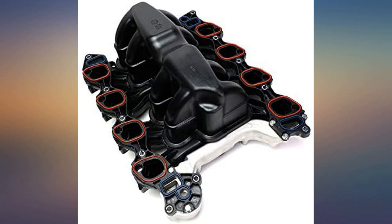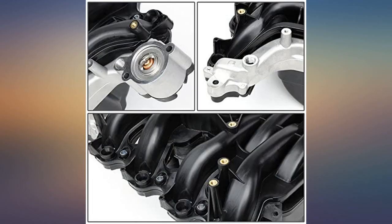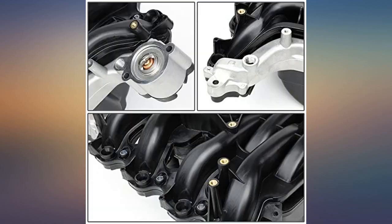Fit my 2003 Town Car with original alternator bracket. Use the coarse thread screws supplied to secure the coils. The intake manifold bolt torque spec is 18 ft-lbs — sequence from the middle out. It's different from the original but they provide all seals and brackets to get the job done.